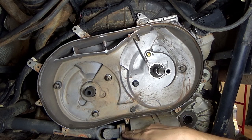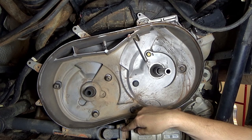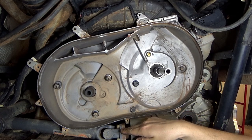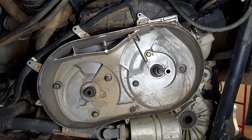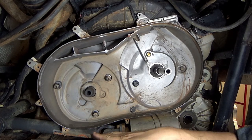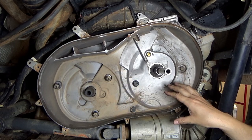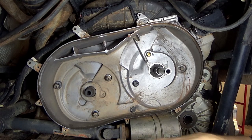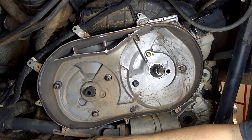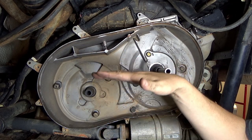I'm not even sure if that's the best approach, because once all this is loose that might be kind of loose too. It might be better to take the driveshaft off first before doing all this. One other important thing: underneath the transmission, once you take all these bolts loose, the transmission is actually like the rear motor mount. So once you take it loose, the motor is going to want to slide and fall down. To make it easier, try to put a block of wood between the pan and the engine to hold it up while you work.